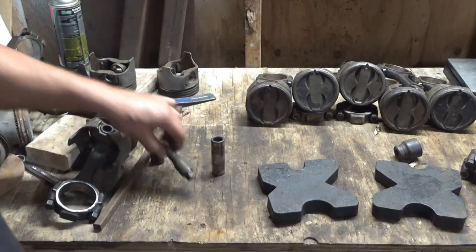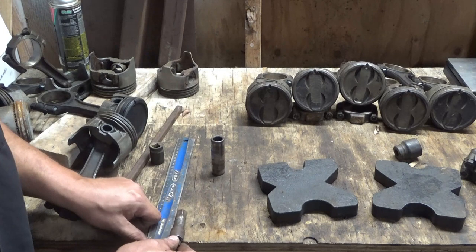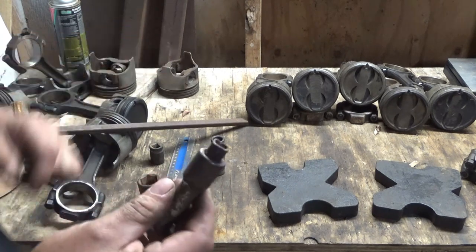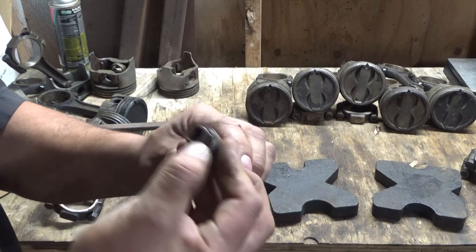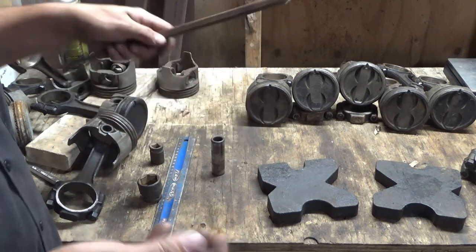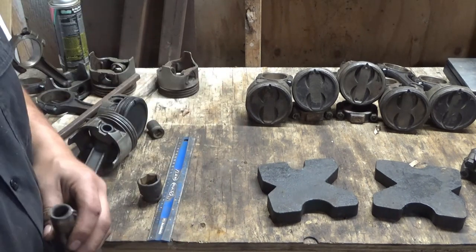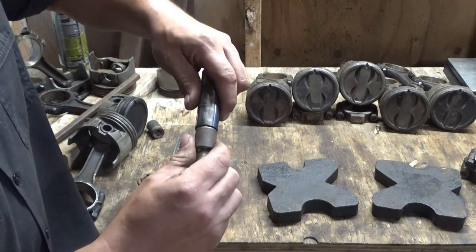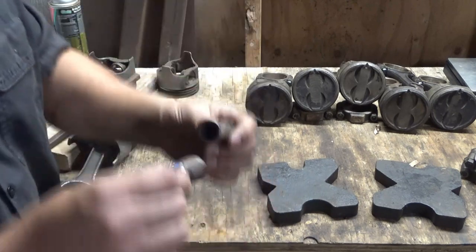Here goes the other part. This extension right here, it's a half-inch extension. The whole thing was three inches long — you should probably use one a little bit longer. I have this little piece of square tubing stuck in there, looks like 16 gauge, a little half-inch square tubing. I cut a piece of it off, crushed it in a vise, and tapped it in — it's stuck in there pretty good. Then I got a junk wrist pin and tapped it in there, spun it a little until it loosened up, and that's what's going to keep my extension centered on the wrist pin.